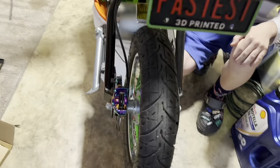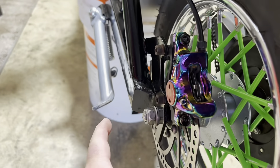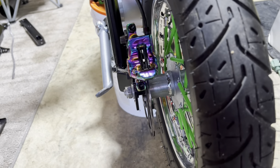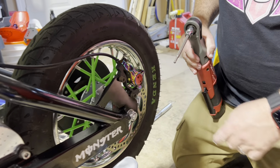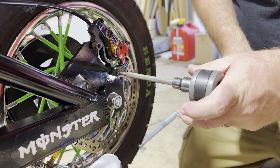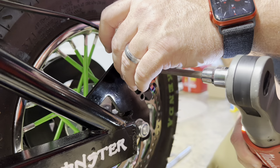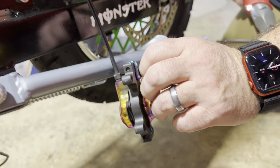You don't have to go in any particular order, but we need to undo the caliper and the axle. I'm going to take off the caliper first just to get it out of the way. Use a 5mm Allen to take off the brake — stock or aftermarket. That's two 5mm Allen screws. Save them, you'll need to reuse them. Then your brake will come off and you can set it to the side.